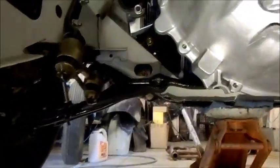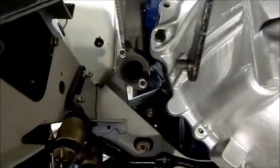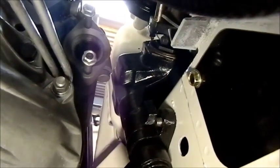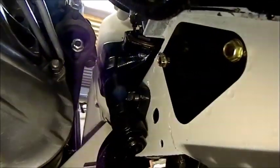This looks absolutely perfect up there where the exhaust outlet is. That's perfect. That's exactly the way I want it. This one on the other hand, it's going to have a bit of a dog leg in it, but it's not too bad. It doesn't look as bad under here as I thought it would. The only thing that worries me a bit is the handbrake cable here, and I'm going to have to fiddle with that. Finding these 289 Hypo manifolds is quite a difficult task, but I'll persevere with it anyway. The other thing I've got to do is bend the transmission filler tube / dipstick to clear as well.